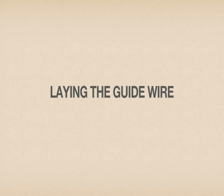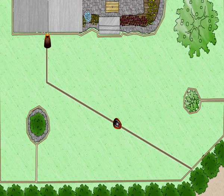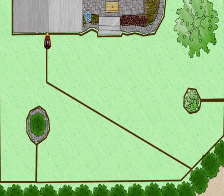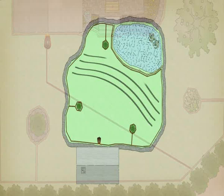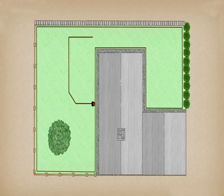Laying the guide wire. Now it is time to lay the guide wire. This wire will help the mower find its way back to the charging station when the timer calls or when it needs recharging. Lay the guide wire beginning at the charging station and lead it to a central point on the opposite side. If you have a slope in front of the charging station, lay the guide wire diagonally so that the mower will have optimal traction. If you have a remote section in your garden, it is a good idea to connect the guide wire here to help the mower find its way back to the charging station. Start by threading the wire through the ground plate of the charging station.